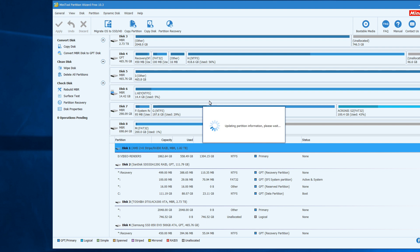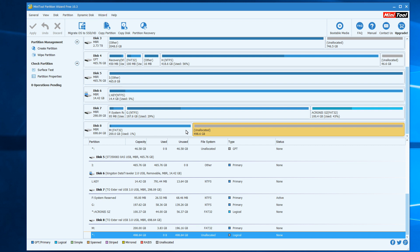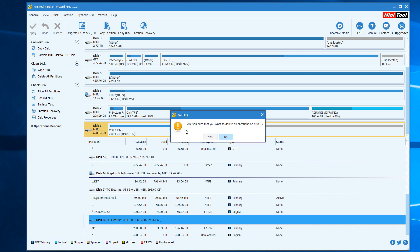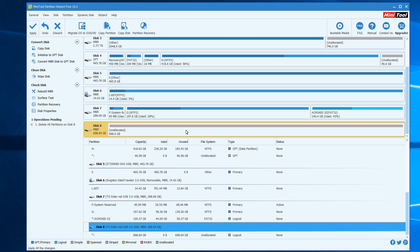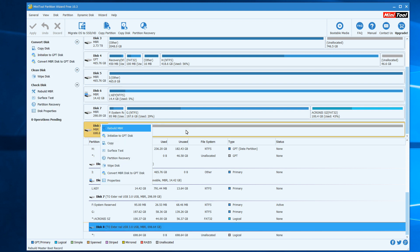To prove which drive it is, I'll unplug the USB drive and watch which one disappears. That confirms it — that was the drive. Very simple. You put the drive in — whether it's 200 gigabytes, one terabyte, or up to two terabytes — this is one of the tools you need for Windows 10. Now we're going to hit 'Delete All Partitions.' Remember this will destroy everything on the drive. Click Yes, then click Apply and confirm Yes.